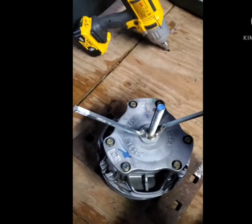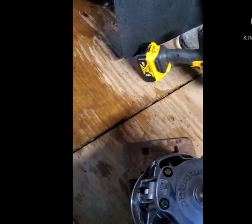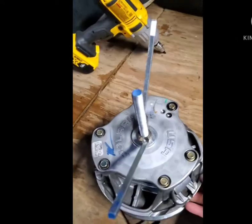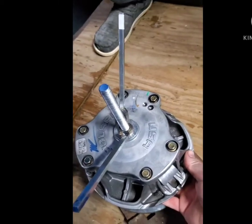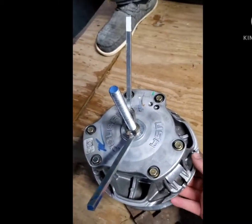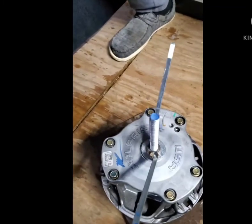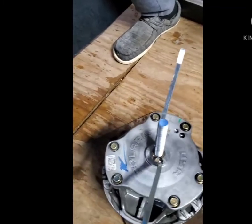If your spring isn't broken, there should be compression on the clutch. When we take the bolts out, the clutch middle half here — this sheave — will drop away. And this will come up as you slowly back the nut off. This prevents it from springing open.